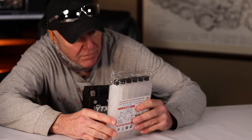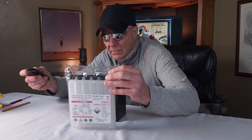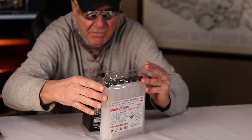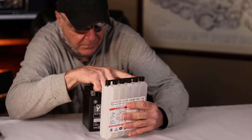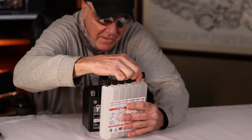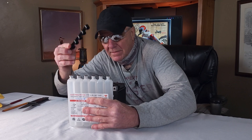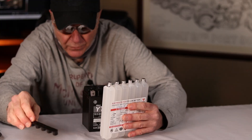Now there's no playing around with this stuff. It is very corrosive, so at the very least you want to wear some safety glasses, and it wouldn't hurt to have some rubber gloves too. Now you want to save this bag, because we can dispose of that container in it afterwards. You'll notice on the top here there's this little cap system, and they're all linked. You want to save that, because that's actually what we put on the battery after — that's the cap to seal the battery, so put that to one side.